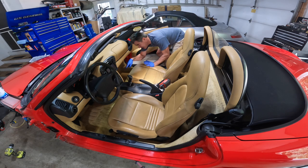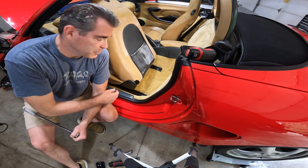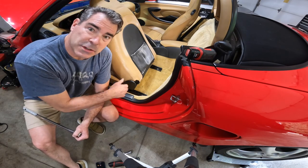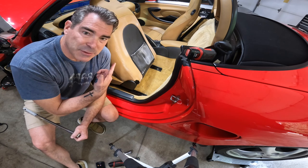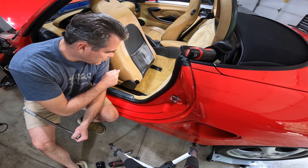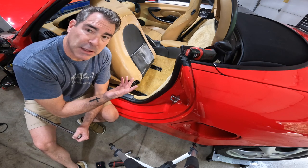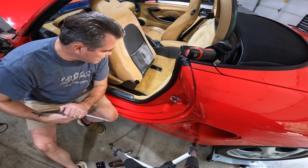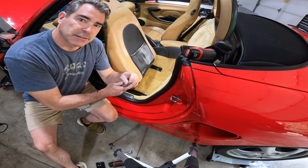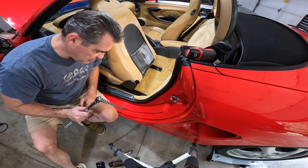Good news is it's clean underneath, but wet. Okay, I had to hook the battery back up so I can move the seats — they are electric, which is a plus. If you guys watched my 996 video when I had the C3 die, I had to take those out too, kind of the same story but electric this time. Get the E12 socket — it fits right in here — I'm gonna break them loose with this and then we'll take them out.